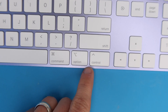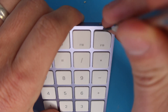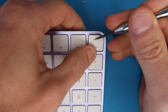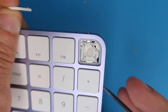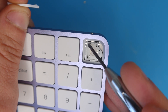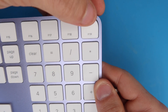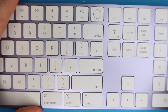The F19 key is a little different — you're going to attack it from the top instead of the bottom. Put pressure down on the lower side while pulling up on the corner, and it releases the clips. You can see this clip is designed differently: the awning clips attach on the bottom and the lobster clips attach up top. For reinstallation, slide the key over the awning clips, push it down a little bit, then snap those top lobster clips into place.